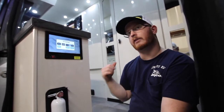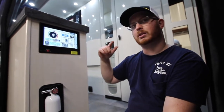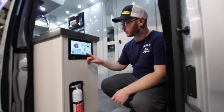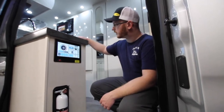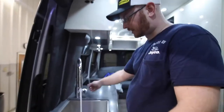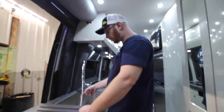The water heater turned off because there's no water pressure in the system at the moment. So I'm going to prime all the water systems by turning on the water pump. Push the water pump switch — it's now blue, indicating it's on. Go ahead and adjust to Comfort, click OK, and it's going to go through its process. Now it's pulsating because that's the style of water pump this system uses. When on hot, it's a little more consistent since the water heater has its own small tank.